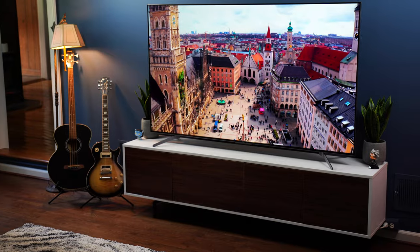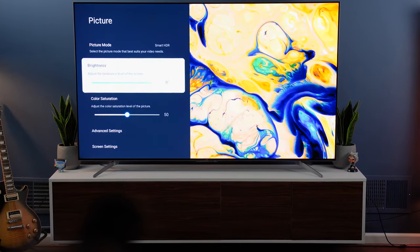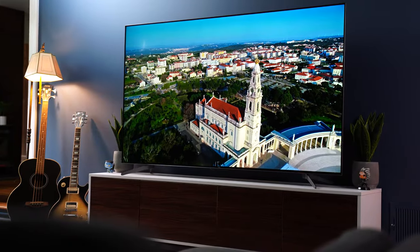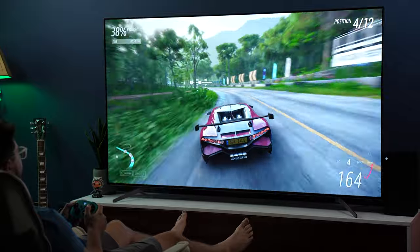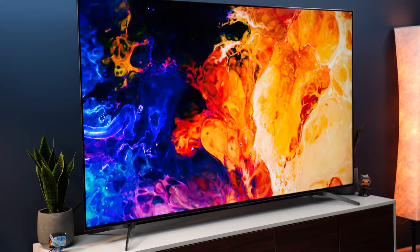The biggest thing with this panel is how beautiful it is. The panel type is QLED — a VA panel with full array local dimming and a quantum dot layer to increase color coverage. Brightness hits around 550 nits of full-screen brightness, but in the highlights goes almost up to 900 nits, and that's just in SDR. This TV's picture stands out from others on the list — it keeps away all reflections and maintains a very vibrant, bright picture throughout the day's lighting. In HDR, the bright colorful scenes look especially awesome, and in game mode the display gets even a little bit brighter. Colors are similar to the Vizio and Hisense due to the quantum dot layer.